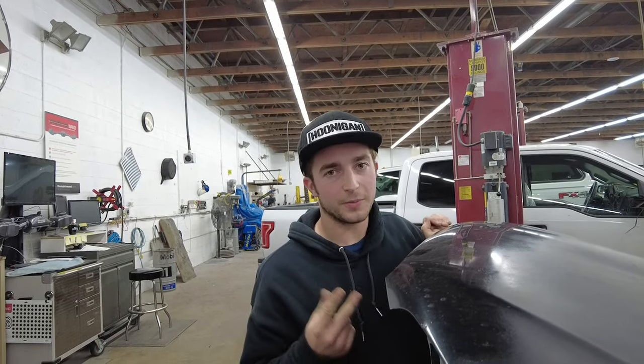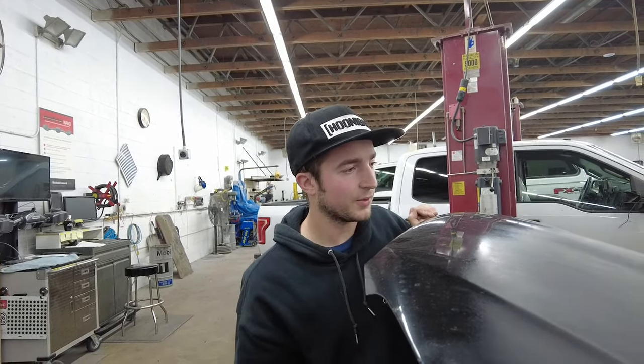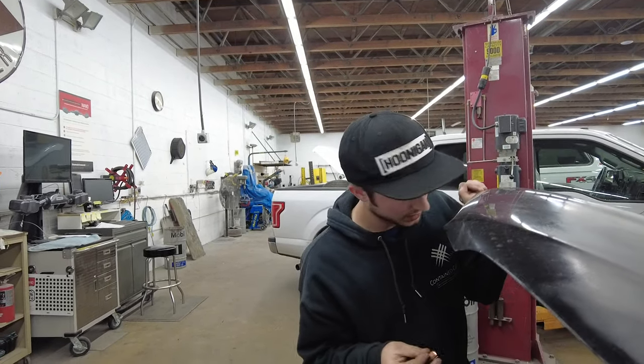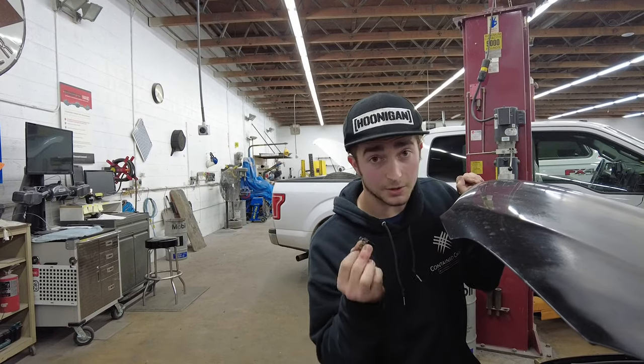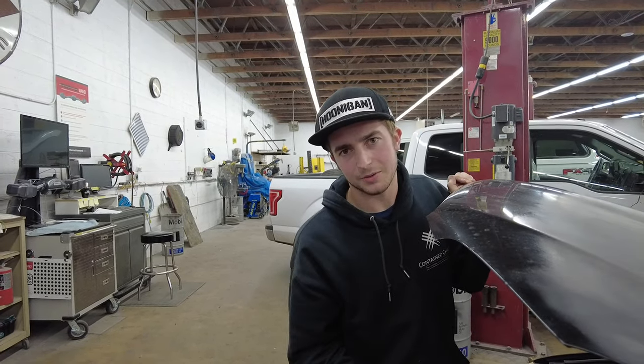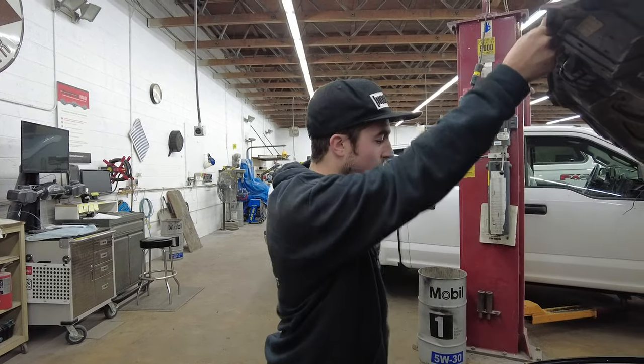her ignition switch, there's two pieces, and one of them always goes bad, and so it's just making it freak out, and it's just in the open, close, open, close, open, close. So we're gonna look into that today. But that's your problem. You gotta replace your ignition switch if this is happening. And I looked it up, and it's really common. So we're gonna do that.